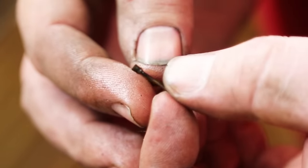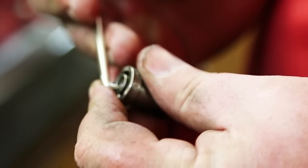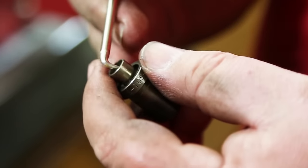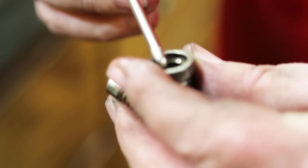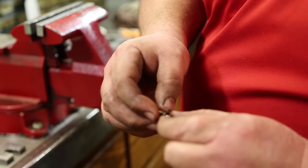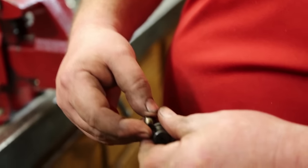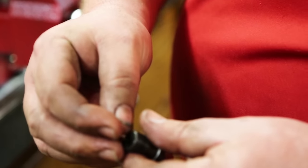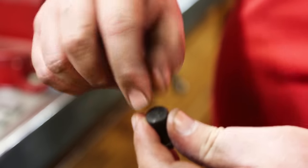And we'll lay these other components out so you can now get a better idea of exactly what's going on here. The holder. There's the spring retainer. It should just come right out of there now. And spring. There's one more little dude down in there. Spring seat. So the spring kind of over that. So all of this resides on this end. The pintle passes through right there. And that's what we've got to lap in. So that's what they're talking about.